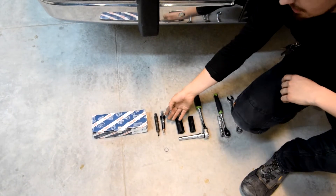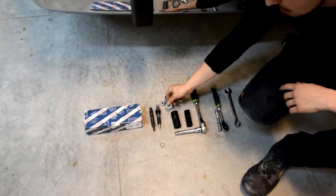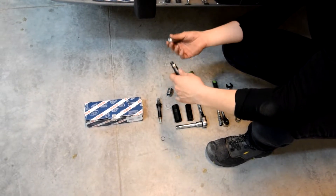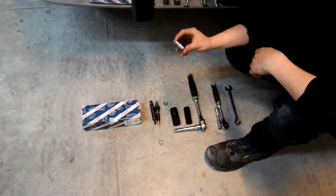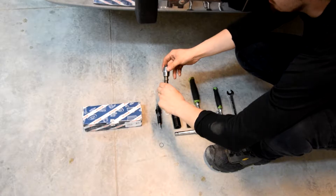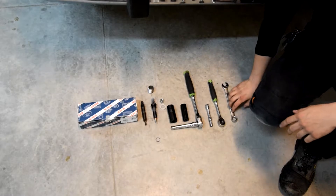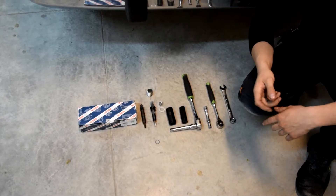The tools you're going to need for this job: obviously some new injectors. This is an M16 washer picked up from a hardware store. This is a lug nut from the parts store — for these injectors it's an M12 by 1.5 thread. We're going to use this to remove the injectors if they're stuck. Also, this is a three-quarter inch pipe nipple that fits perfectly over the injector and sandwiches between the cylinder head. You need a 24mm socket, 19mm socket, some ratchet drives, a 10mm, a 17mm wrench, and a few other miscellaneous hand tools.